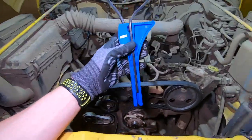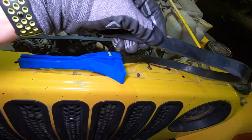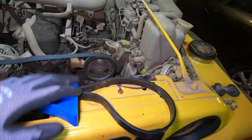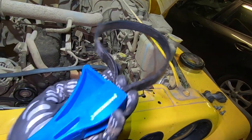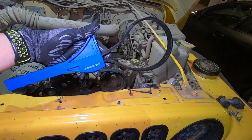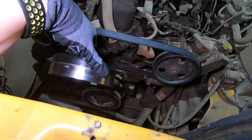Here you can see the strap wrench a little better. Basically it's just a plastic handle with a rubber strap. All you do is put it around whatever you want to use it on - maybe an oil filter, a pulley, anything round that you need to grip. Feed it right back through the handle and you can only turn it one way so the teeth grab. Depending on which way you want to use it, you just flip the handle. This was really cheap and works great - it came with two sizes for about 15 bucks. I've got my pulley off already.